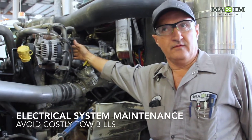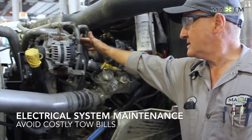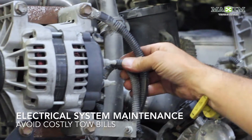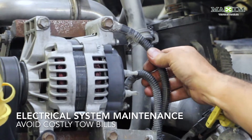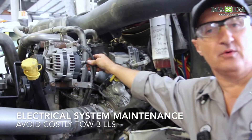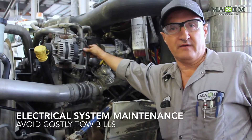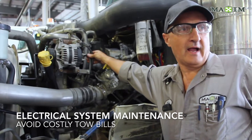This is a good example of keeping connections clean. These are the alternator connections — this is the ground at the top and this is the main battery power up to the alternator. As you can see in this example, they're both clean and easily accessible, and you can feel if they're getting loose or not. Looseness and cleanliness are the two most important things with all of your major electrical connections. If you keep them clean and tight, you shouldn't have any problems unless you get an outright failure on the alternator or the starter.